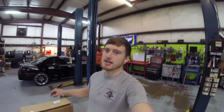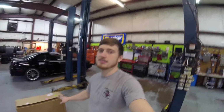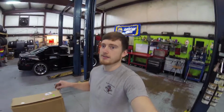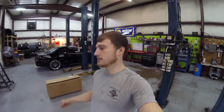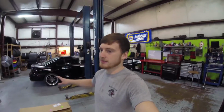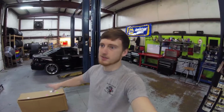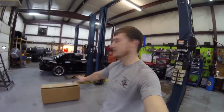But what I ordered was a Ford Performance Super Heavy Duty T5Z. And I know everybody gives the T5Zs a lot of crap, but I've been doing a lot of research, and most people that actually have one of these T5Zs say they're really good. They haven't had any issues with them. They're rated at 330 foot-pounds of torque, which I'm sure my car has more than that, but like I said, these guys got upwards of 400, and they said they're holding up fine and had them for a few years. Let's get to unboxing this thing and show you what it looks like.